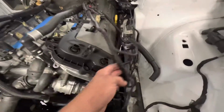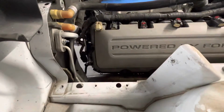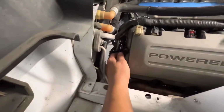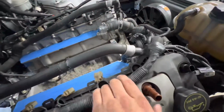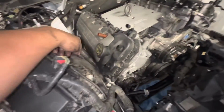Still have to pull off all the coolant lines and the rest of the harness that wraps down on the driver's side to the alternator and such. O2 sensors. Whatever else is on this side, I have to take off the AC compressor, disconnect it, and I'm leaving the headers on, of course. There's some connections back here that have to get pulled. I'm probably not going to pull off right here. Pull it off on this end, wherever they route front to, and then drape them off to the side. That's it. So a few hours later, all the harness and coolant lines are taken off and apart.